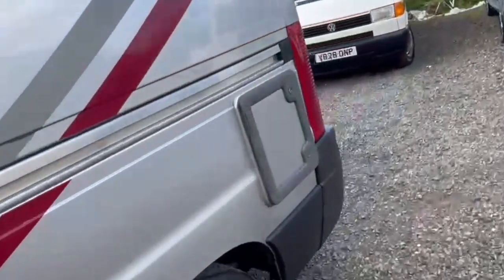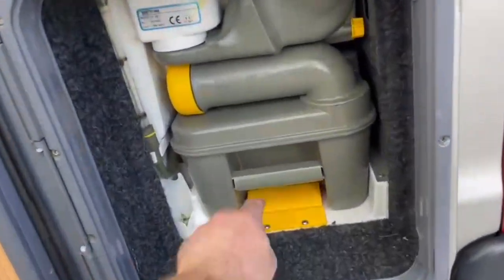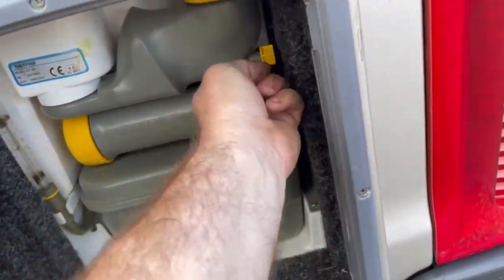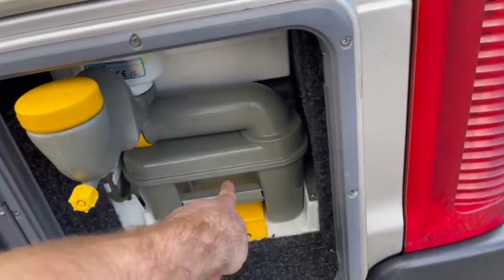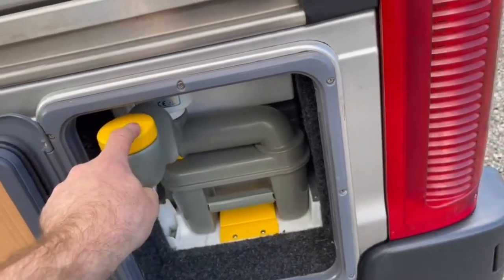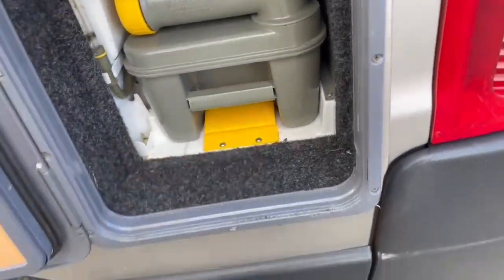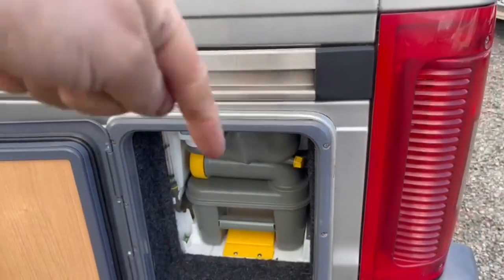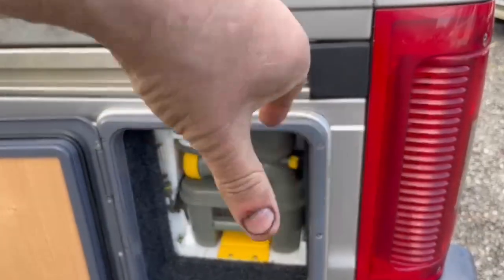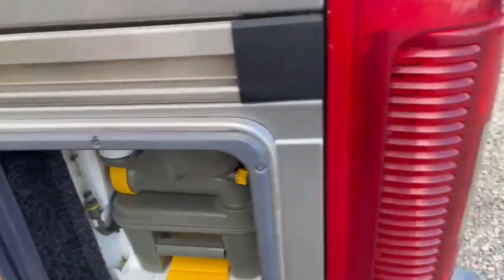Going in the back to show the wet room, toilet area, and shower. This is the Thetford cassette toilet. You've got two chemicals — blue and pink. Pink for the stink, blue for the loo: pink fluid goes in the bowl for the flush and blue goes in the cassette. Press that button and it pulls out. If it's solid, don't force it — that means the closure on the bowl isn't quite closed, so make sure that's closed first.